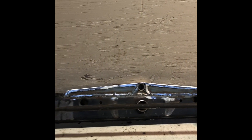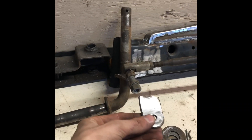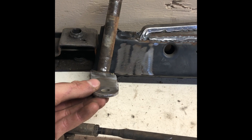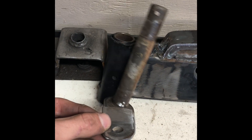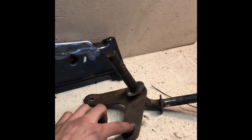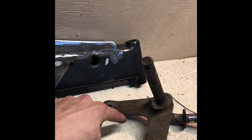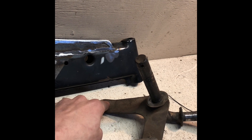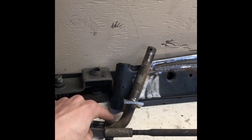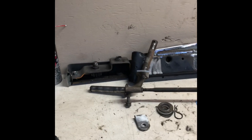So some spindle work: the original steering arm sat over here, kind of long, welded on here. I'm gonna shorten it and bring it closer to the frame. I'm also going to be rebuilding the tie rod - I'll be shortening it, moving this hole closer to the spindle and this hole closer over. It might even be a little bit closer and bent down a bit - we'll see when we get to it. Then the rest will be a gusset or brace from here to here, same thing on the other side.